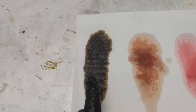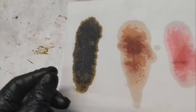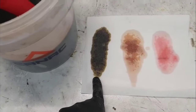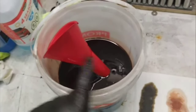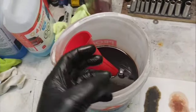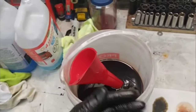So if your transmission fluid looks like that, you really don't want to change or flush the transmission, because you're going to remove all the metal flakes. I talked to you about it, and you risk having a slipping transmission, so you're going to break it. If your transmission fluid looks like that, because your bucket was clean, you're going to put the oil back inside your transmission. In this case, you're going to save the transmission. I explained why. This is the reason why I use a clean bucket to take the old oil, because I don't want it mixed with engine oil or coolant. It can be left in my regular catch can.